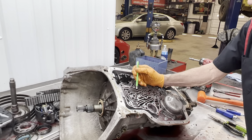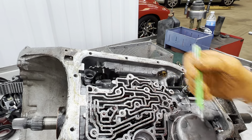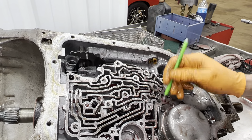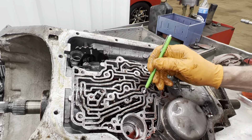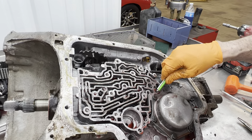We've got all of our check balls here. If I would have been building this personally, I'd have left that check ball in and this check ball in here, and then every one of the others have been chunked out of the hole — throw them away. You only want to leave two, that one and that one.